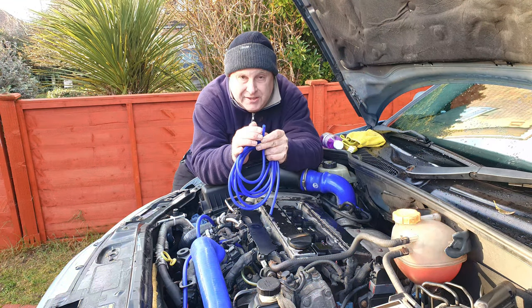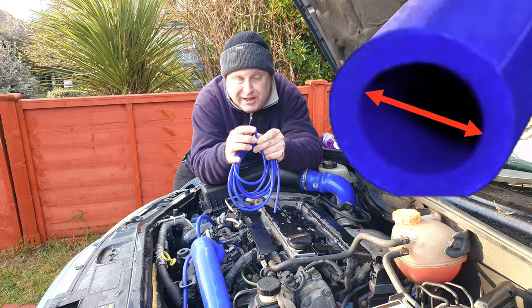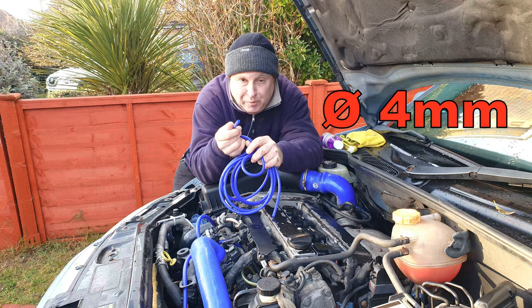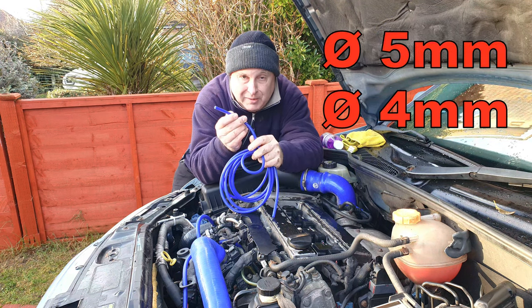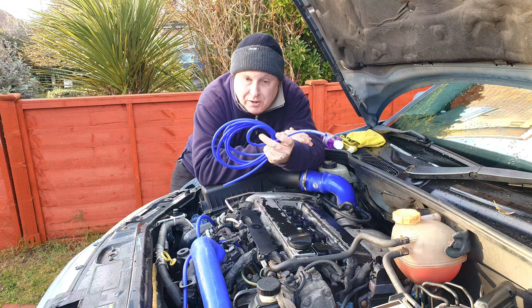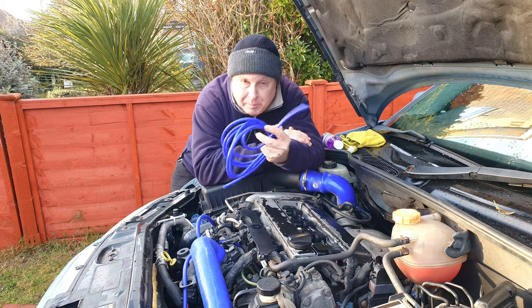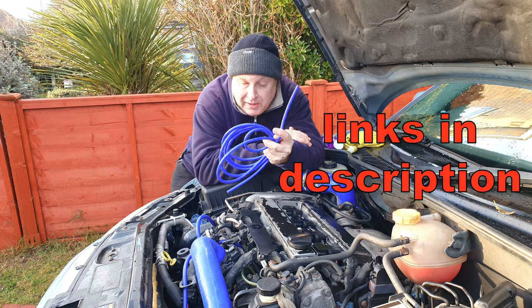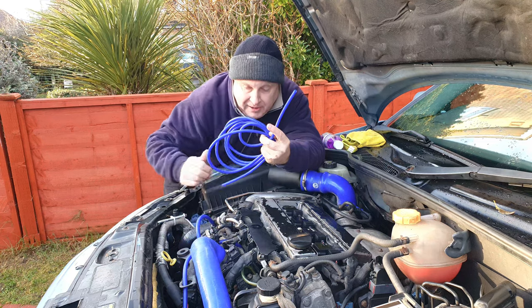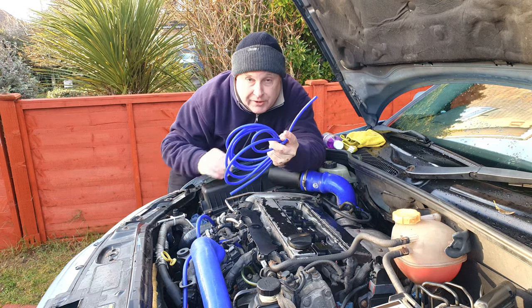Vacuum hose size is specified as the inner diameter. You'll need two sizes: a length of four millimeter and a length of five millimeter. I bought two coils, one each size, three meters long, which would appear to be plenty. I'll put a link in the description to the hose that I bought, which is from the same people that make my intake and coolant hoses.